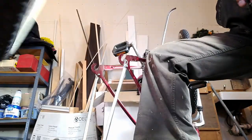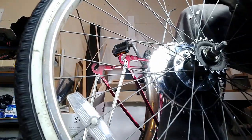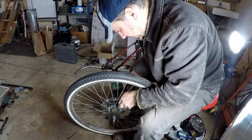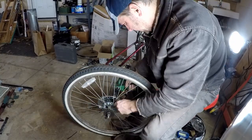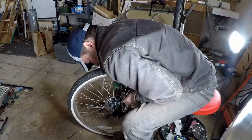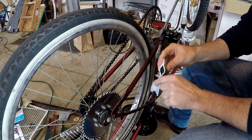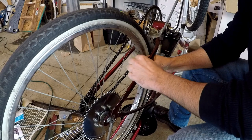I'm applying the bolts to the nuts in a staggered pattern and tightening them down so they have nice, even, firm pressure on the spokes. I want to point out that on this back drive sprocket, it's convex or concave depending on how you're looking at it. That's in order to line up the chain properly. I like to have the teeth of the sprocket facing out — away from the hub rather than back in towards it — as it gives the chain a little more room away from the rotating spokes.